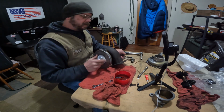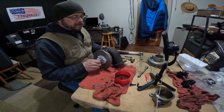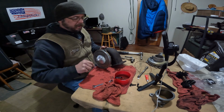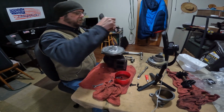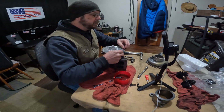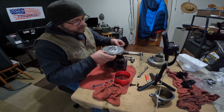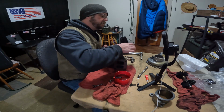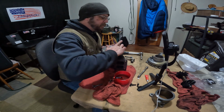Gently pull that down, take that off, spin it. Oh yeah. No noises. No play. Just whiz, whoosh, turbo noises. Then you got your O-ring seal. This is what allows the turbo boost to go where the boost is supposed to go. Without that seal, you'll have leaks around the housing and lose boost.